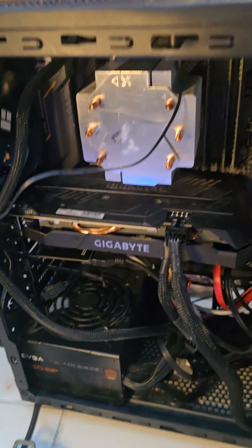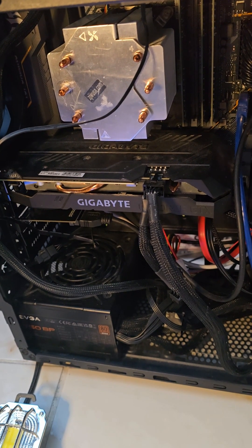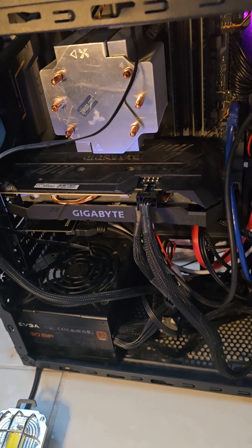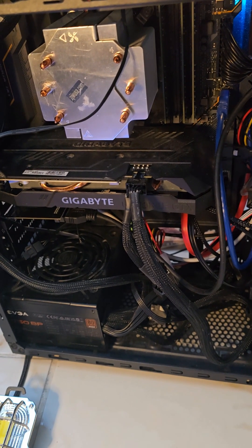Well, that was your PC tip. When you want to upgrade from a box, standard, or factory CPU cooler and you want to put a much larger one, most cases have a cutout in the back where you can easily access and put on the back plate and be able to attach a new one.